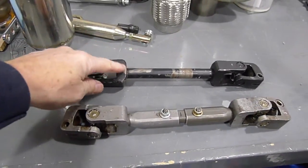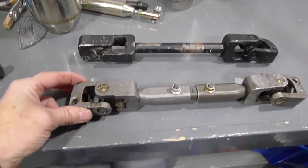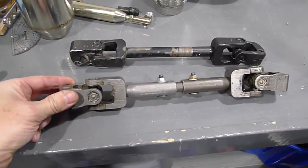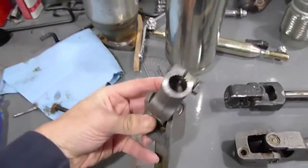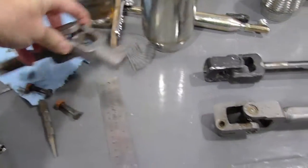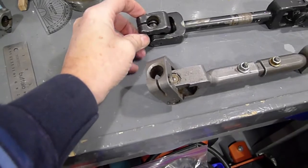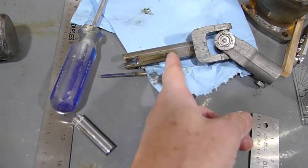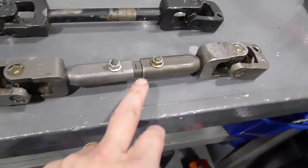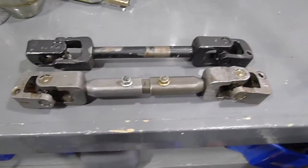Here's the original Mark 1 steering U-joint system, and here is the fabricated system I took from two different Mark 3 steering shafts. The Mark 3 has a different spline for the steering column, but it has the same 11/16th diameter, 40-spline as the original Mark 1. You can take a bolt out and slip this end off, and then I just cut this and machined another groove in it. So this is adjustable now, and the best length for my setup with everything aligned correctly is about a half an inch longer than stock.